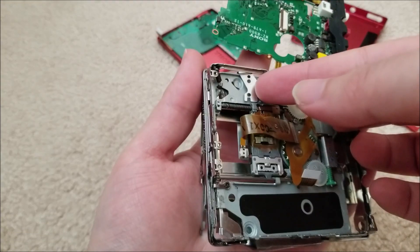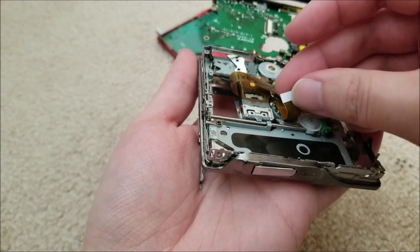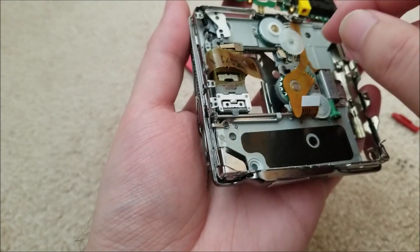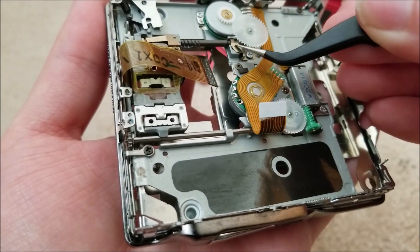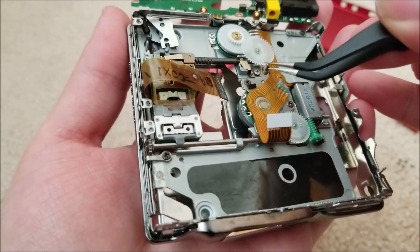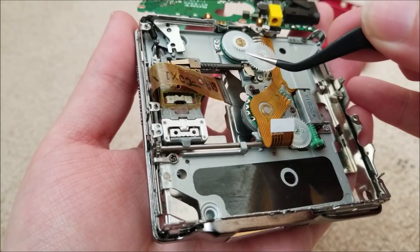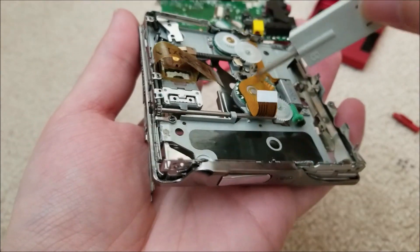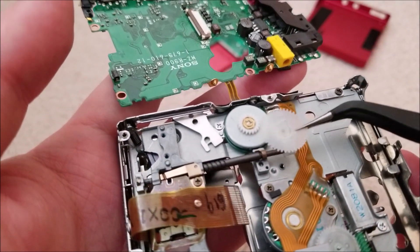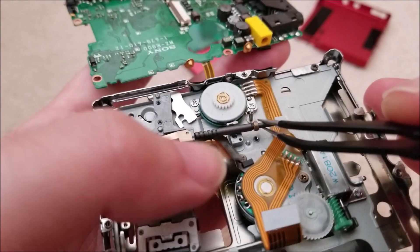The head is now free — you can see it's just floating there. Now we need to figure out how to get the laser out. It looks like we're going to have to go pretty deep into the mechanism. There's a single screw that holds a metal finger pressing down on a bar, which is the worm screw that moves the laser up and down. If we loosen that and get the bar to swing out, we should be able to pull the laser all the way out. To safely do this you need to remove the cog — just the top one. There's a split ring washer on there that you have to remove, then carefully lift this off.